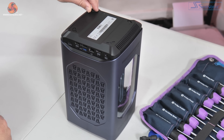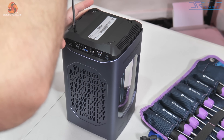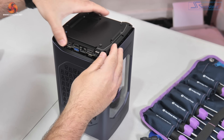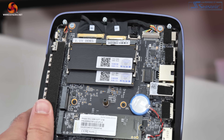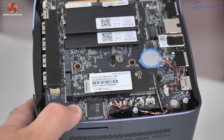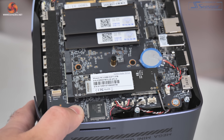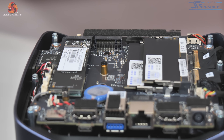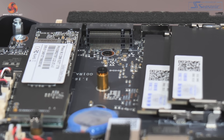Moving on to taking the system apart — you first remove the four rubber feet from the underside to reveal four screws holding the bottom panel in place. That pops off and there are a couple more support brackets to remove before you get access to the underside of the motherboard. Here we can access the two SODIMM slots, each occupied by a 16GB module, while there's also one 2TB Phison E27T M.2 SSD installed and a spare M.2 slot next to it, though this is limited to 2242 drives and not full-size 2280 M.2 drives.